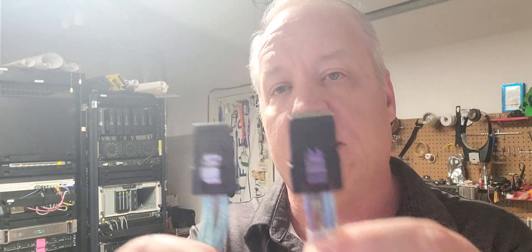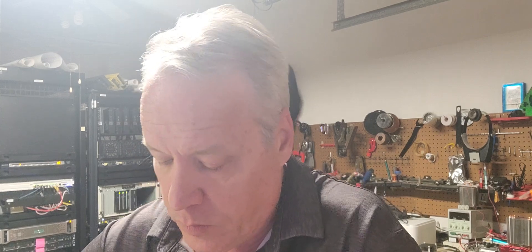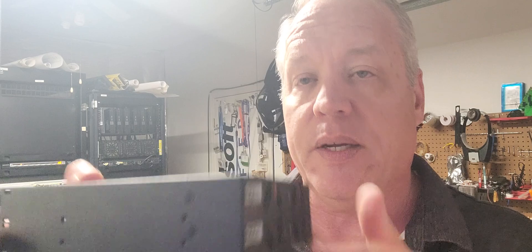You'll also see another kind of SAS switch cable which has the same edge connector on both sides. You'll find some installable disk array platforms that allow you to directly connect the SAS interface to the disk array. Usually they're small and you get a four-port disk controller that plugs into the back of your disk array as a single connection — and that's a single path.